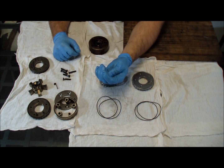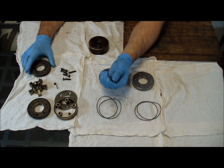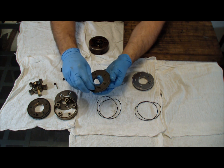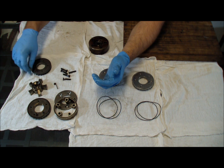Another symptom you'll see is the car will clack really loud, almost like a rod knock. That's on cars sometimes where it's more than just the guides — the pin is actually slipping in and out until the car has enough oil pressure to hold it in. So that's another issue as well.